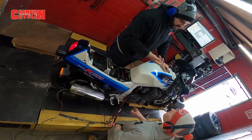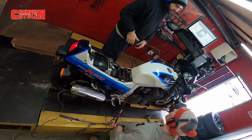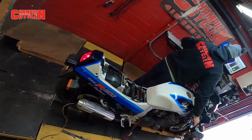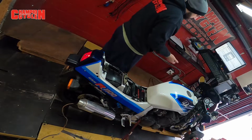The throttle is shut, the fuel has nowhere to go and no air is coming in. So it's just pop, pop, pop, pop. Afterfire, right? It's decel pop, we call it. That's normal. There's nothing you can do about that.